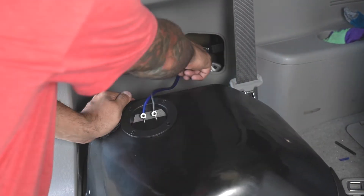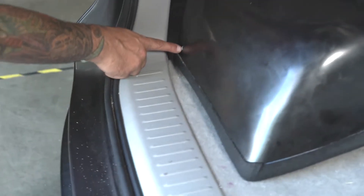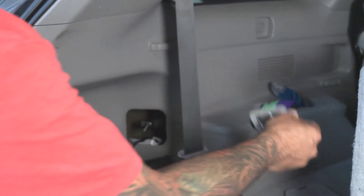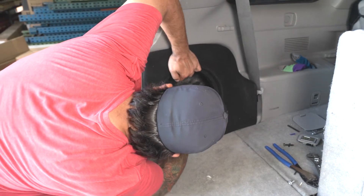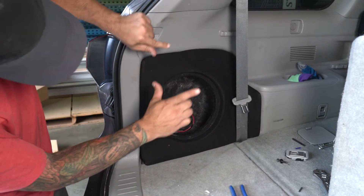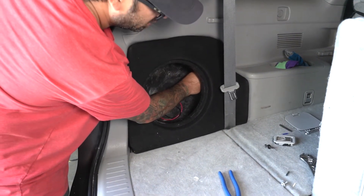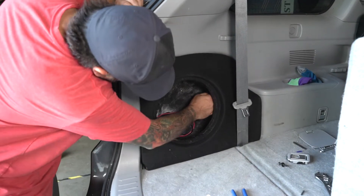We're going to go ahead and align the threaded rod through this hole here. As mentioned earlier, there is a little hole here for us to bolt the front of the box to the mounting point where the cargo hook originally was. Lining it up can be a little challenging, however with the woofer out you'll be able to see and line up that threaded rod through the hole. Once you get it through, take your washer and your nut and tighten that down — it's just a 10 millimeter, so you should be able to tighten that down pretty easily because there's plenty of room inside the box.